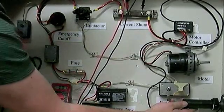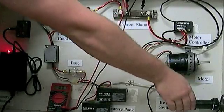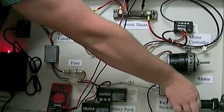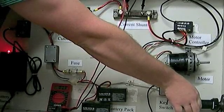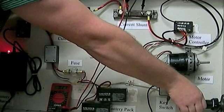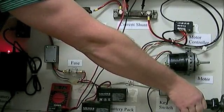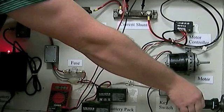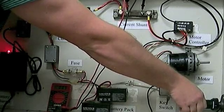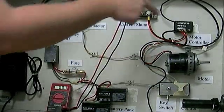Of course I don't know what that is in actual amps, but it's only a small amount. As I apply more and more twisted throttle input, we're going to get higher RPMs and a higher amperage draw, so we'll see this number change. As I increase slowly, we see 0.8 — then 1.2, 1.4, 1.6, up to around 2.4 millivolts at full throttle. Just like the voltage sag on the battery measurement, this is doing the same thing — measuring a millivolt voltage drop, and that ratio equates to however many amps you're drawing through the positive lead into the motor controller.